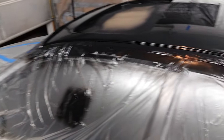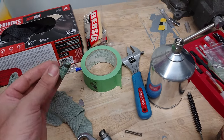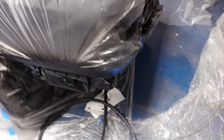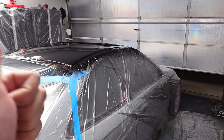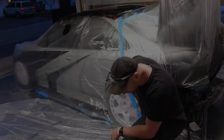Spraying at night with the lights on and the garage door cracked, I was a little worried about bugs and we only got one bug in the paint. Another issue was the top of my paint gun wasn't sealed perfectly, so I wrapped a microfiber towel around the top. I had one drip in the paint, but as a user suggested on one of my old videos — keep a little masking tape on hand and just touch it to suck up the drip — and it worked great. The bottom portion turned out really nice. I just did the wax and grease remover and let her rip with two medium coats. I was really careful dialing in my gun because I did not want to mess this up. I'll take off the masking tomorrow when I get home from work — I cannot wait to see how this looks.